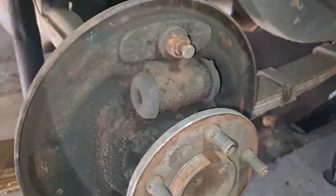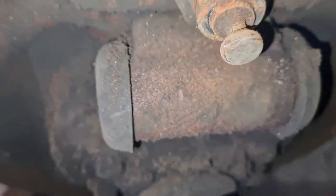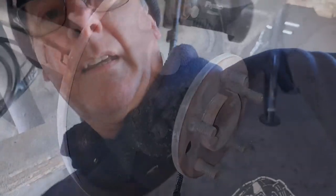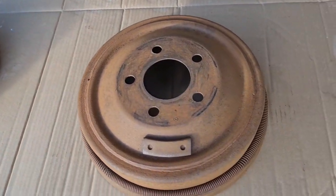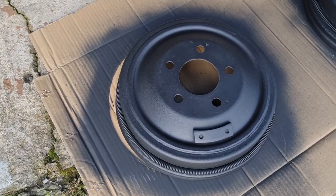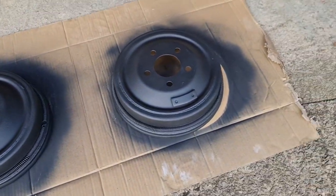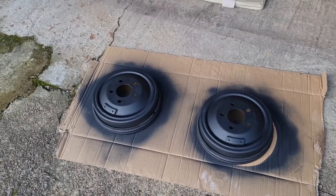So I need to release the brake line from around the back. I've put some WD-40 on there as well so that's had a good soak. I'll take that off, take off the wheel cylinder, and give this lot a good clean. Right — I'm going to clean up the brake drums, paint them, and let them dry while I clean everything else up. There are the two drums cleaned up, painted with some black stone chip. I haven't got any gloss but hey, no mind — they look tidy, I'm happy with that.